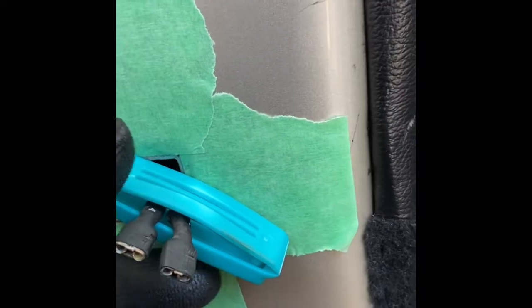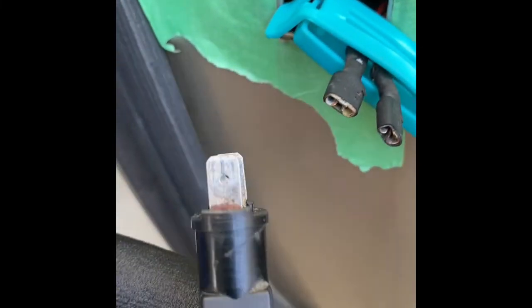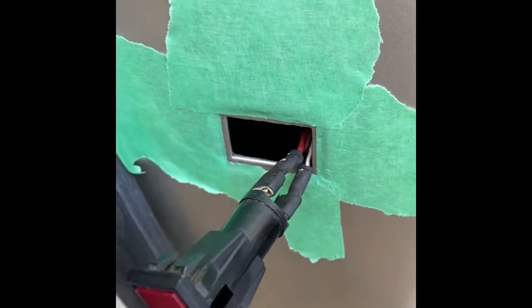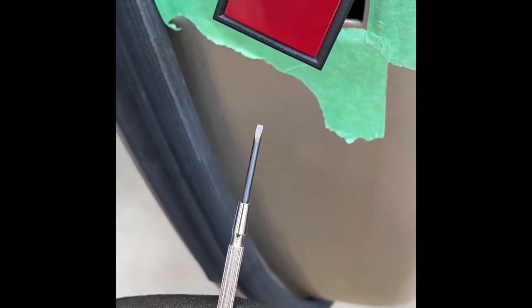This just connects in there. The other really important part here is on this car — you can see the red wire and then there's a brown or brown-white wire. The red wire is the one that goes to the positive terminal — that little plus sign right over there. Just make sure that you don't reverse them and that you double-check the wiring is going to the correct terminal. So it just snaps back in, and I've put some painter's tape just around the door jamb so that I don't scratch it. I literally just pried this off very delicately with a small auto screwdriver. I'm just going to click this back in — that's all there is to it, very similar to pulling it out.